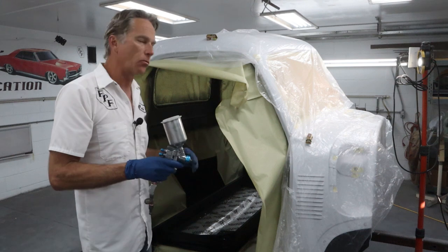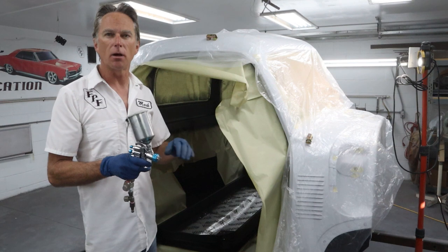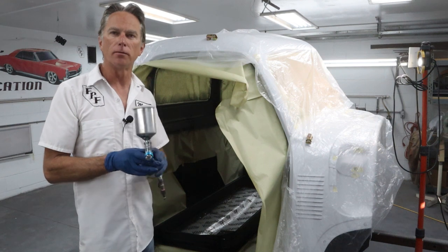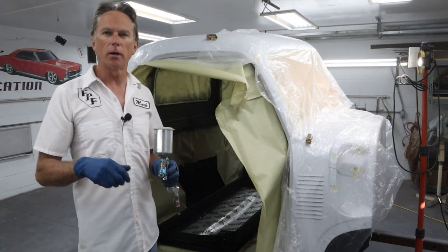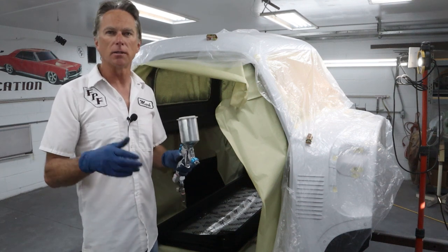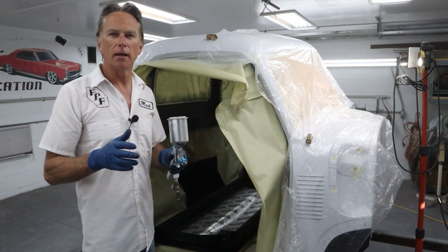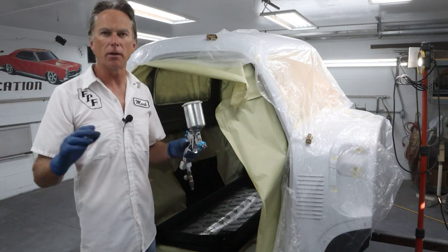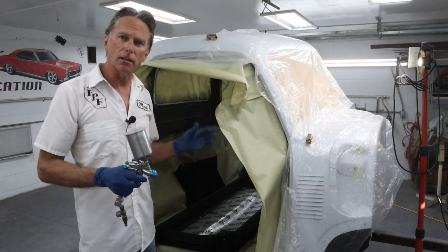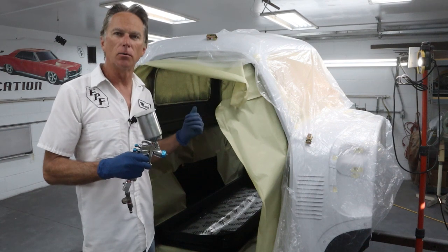So I got one good coat on everything. We're going to let it flash off, go back with the flashlight — if there are any areas that are super blotchy, I'll spot those in with the gun, let it all flash off, then go over the whole thing again with a full medium coat to get everything covered really well. And that's the beauty of base coat with a solid color like this: you can just touch those areas in. If it was a metallic or some other difficult color, you'd have to do a control coat over the whole thing. But with solid color it's super easy. I'm going to let this flash off, get some more coats on it, and I'll bring you back once the air is cleared.